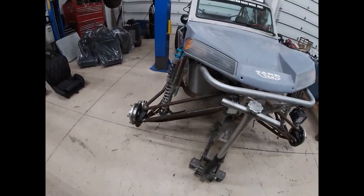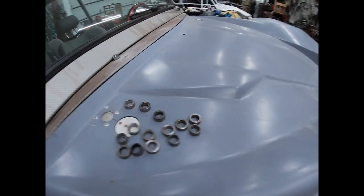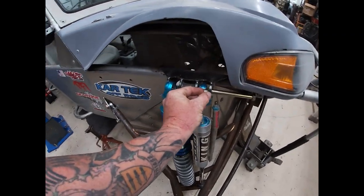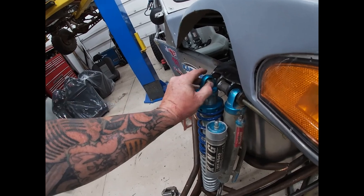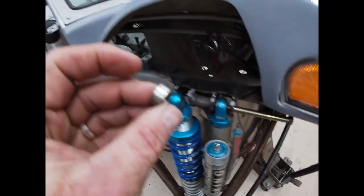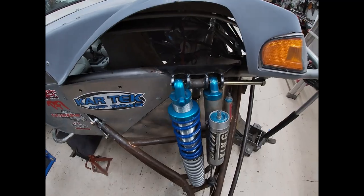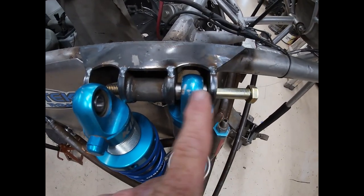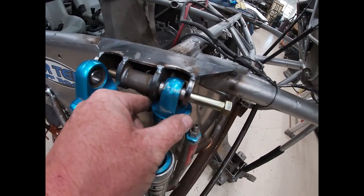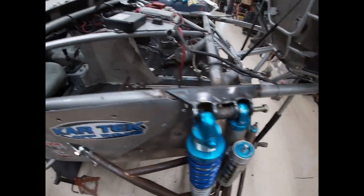Joe's out in Glamis this weekend so I've got some time to get this thing finished up. I've got my high misalignment spacers all set out - we've got a bunch of different ones in different thicknesses. We take these and they sit just like that as the shock goes in, one on each side, taking up all the gap. Looks like two of this size will work perfectly for the front, so we'll get that in there - a spacer on each side with the bolt through.